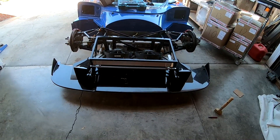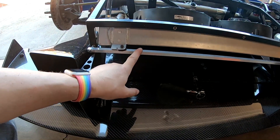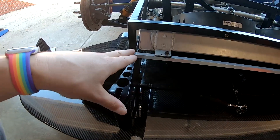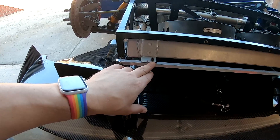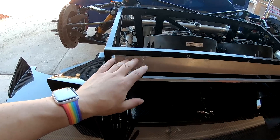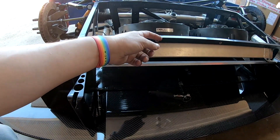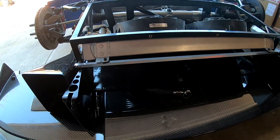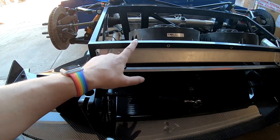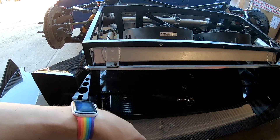Here's my solution for the front radiator mount setup. I've lowered the mount from basically underneath the bar and ran aluminum stock across, tying back into the radiator frame and supported by the top of the nose mount — load spread with a washer and soft washers on either side. It's locked pretty solid. I'll need to add some washers into the back so I can slip the condenser mounts underneath, and then either make new straps that come up or move them down into this same piece of tube. The fab part is done, and I'm going to paint it gloss black to match the rest of the radiator frame so it doesn't stand out when you peek under the nose.